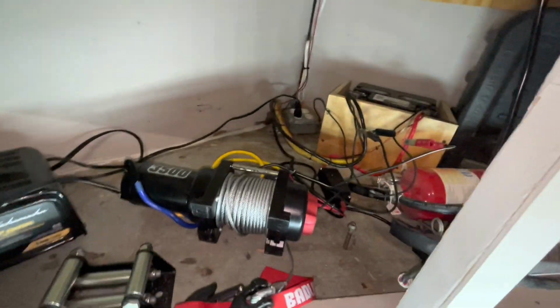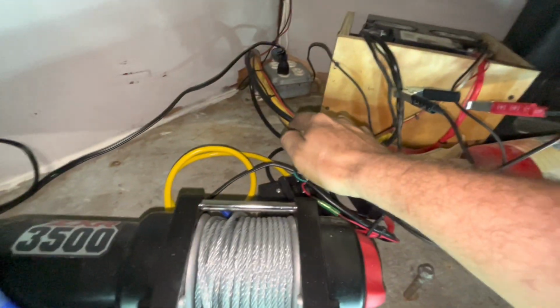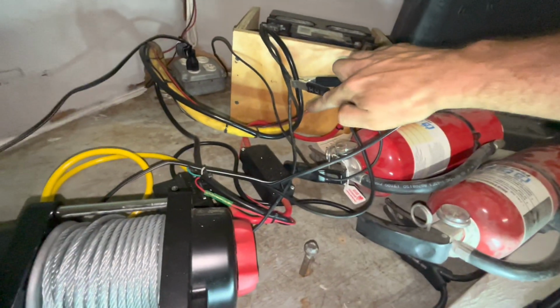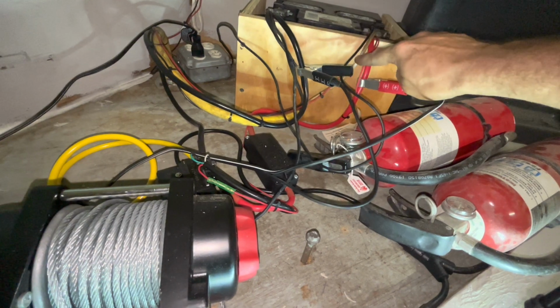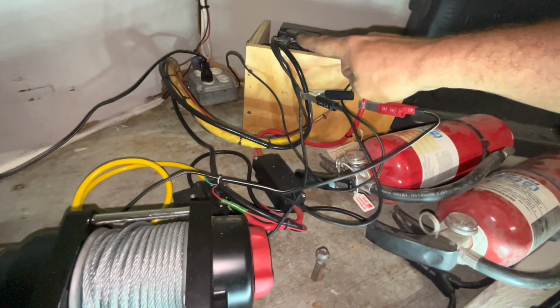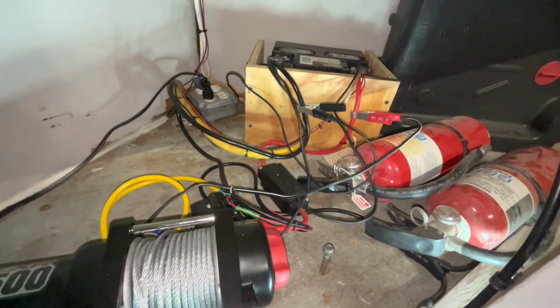I've had it. Today's not been my day. I feel like I can't make any freaking grounds with this trailer hardly. And here you can see right here where my wires run in from my trailer. So it's this yellow wire that goes up to the junction box. Out of the yellow wire comes this white wire that's right here, and sure enough I've got it on that side and I've got all the blacks on that side. So let's flip this and see if this fixes our problem.